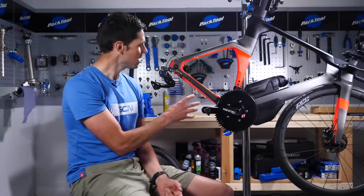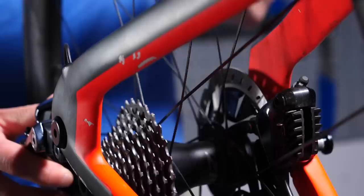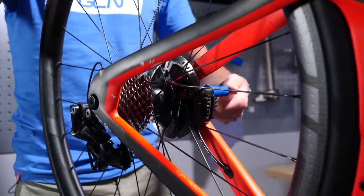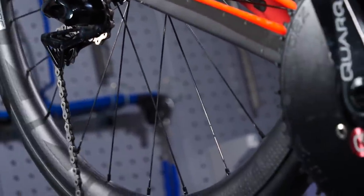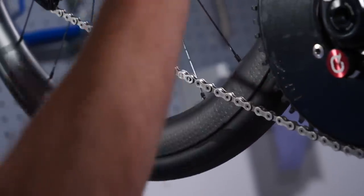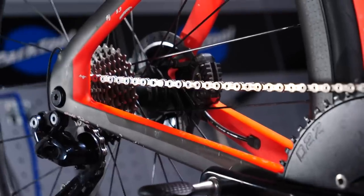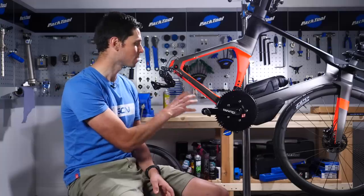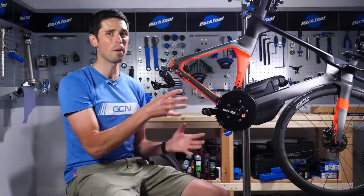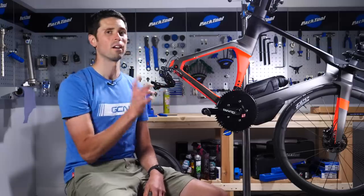The next thing is to put the chain back onto the bike. We don't have a front derailleur to worry about, but if you've upgraded to a larger chainring, you are going to need to make your chain slightly longer. The correct chain length needs to be long enough to use your single chainring at the front while still being able to use the largest sprocket on the back, but not so long that the chain becomes slack in the smallest sprocket. Err on the side of caution — you can always make the chain shorter, but you can never add links back in once removed, as the chain is never as strong again. It's a bit of trial and error until you get it just right.